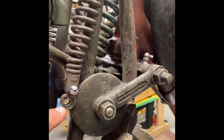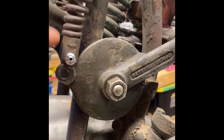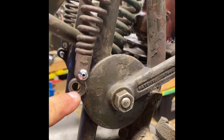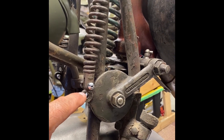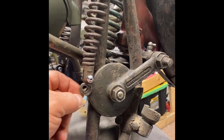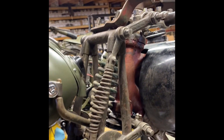One of the telltale signs of how much use these bikes get is usually right here — this is a pin that goes through there, that's your spring, a little rebound spring. On a couple of other front ends I have, these are really oblong, just to give you an idea of how much wear they had. This one's actually really nice; looking forward to painting it.